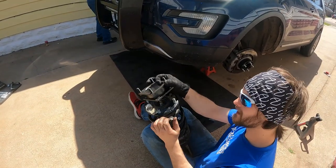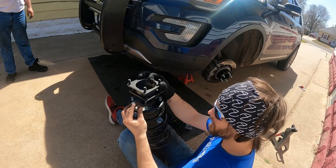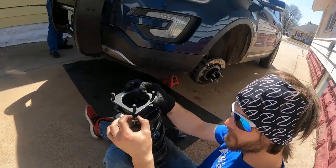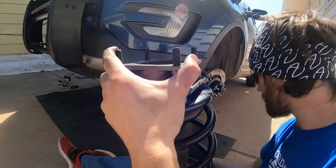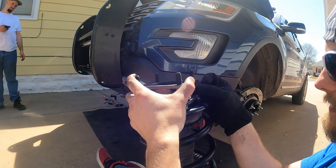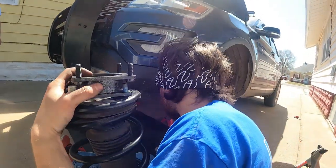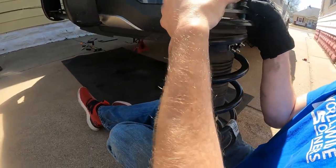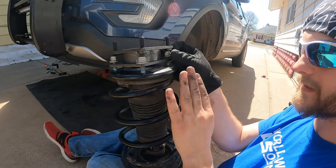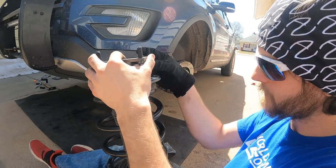Alright, so now I've got my notch here and there's a notch on the assembly — all we've got to do is line those two up and get your mount in there. You've got to start your nuts before you put this all the way down, which is also why we had to cut it a quarter inch. We'll get all these on here and then start sinking them down together, and that'll bring this down and we'll get them nice and tight.